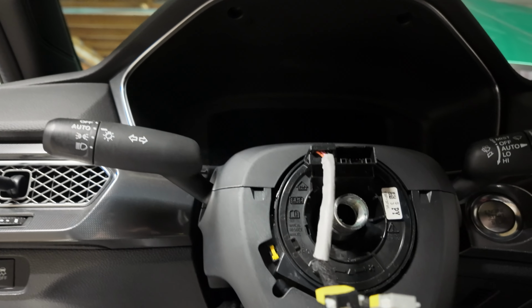And so when I was testing for the actual assembly to move in and out for the steering wheel, it would come out, but then it wouldn't want to go in, like it was caught on something. I moved the wire, kind of freed up some space, and then I tested it. Now everything works perfect. So just so you know, that's the trick. But in case you're wondering, it's the left wire that goes to this module here. So I don't know, it felt like it was just caught up in something back here. I'm not sure where. I could barely see, but it seems like that kind of did the trick.